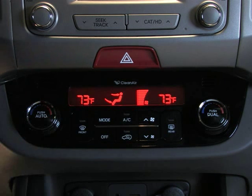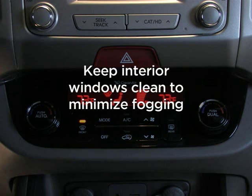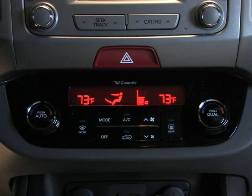In case the inside windshield fogs up, select maximum fan speed and the desired temperature, then press the windshield defroster button. The windshield defroster button will light up to indicate it has been activated. Turning on the windshield defroster automatically activates the air conditioning and opens the fresh air vents. To help minimize windshield fogging, keep the inside of your window clean. Having the cabin air circulation feature set to fresh air also helps prevent fogging, as fresh air is allowed inside the cabin. Drawing fresh air from outside the vehicle reduces built-up humidity in the cabin that fogs the windows and decreases visibility. Allowing for fresh air also helps to reduce any stale or musty smells that may arise in the cabin.